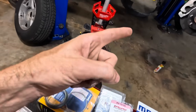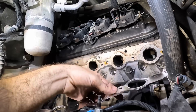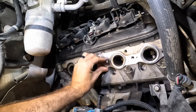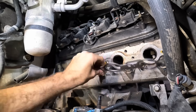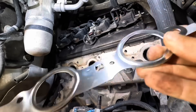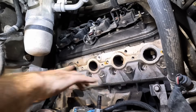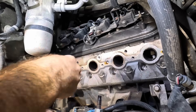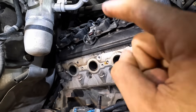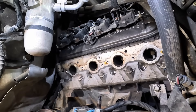I always change these guys when the manifolds come out. Now that we've got all the parts we need to finish assembly, let's start getting this stuff set up and in position. So we've got our new multi-layer steel gasket here — that's going to slip right in and get bolted on with the exhaust manifold. We'll get a couple bolts through there, get it all wiggled into position, then bolted back onto the head. Then we can throw the spark plugs back in, rewire it, and move on over to the driver's side. This will go very easily — all the hard part is done, it's all smooth sailing from here.